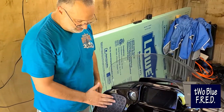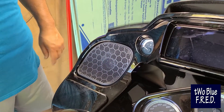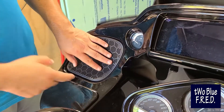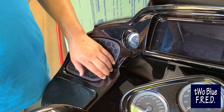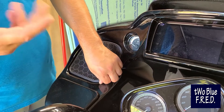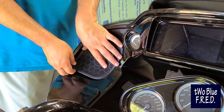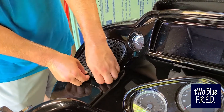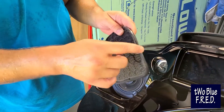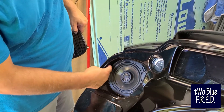First step in removing the cowling is to get your speaker grill covers off. These are just plastic, using some little clamps behind. You don't really want to use a tool because you'll scratch up your paint. If you have a plastic tool that's fine, but truly you can get in here behind it with your fingers and just sort of work your way up, grab hold of it, and it comes right out. You've just got these little plastic lips, these plastic little springy clips that go into notches on the side.